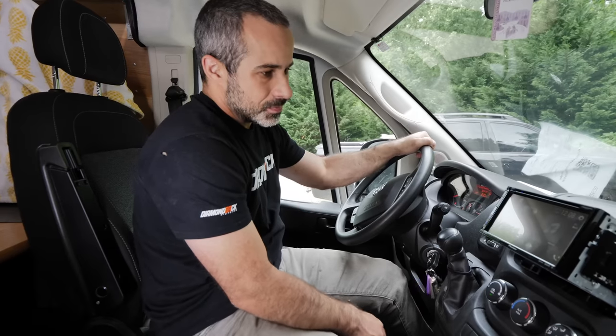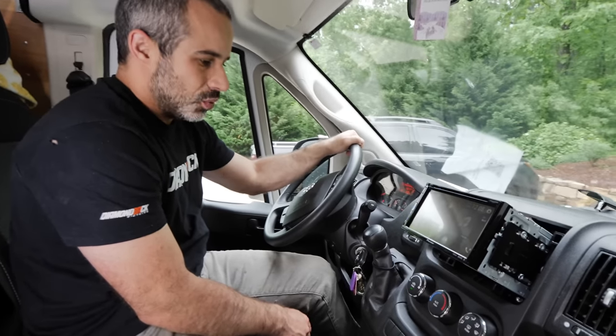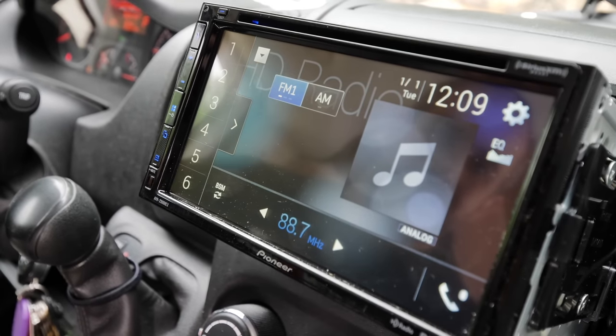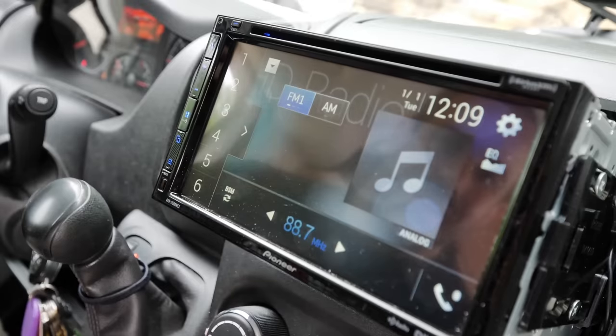Here's the moment of truth. Backup cam — I put it in reverse. Can we adjust the brightness on this one? Watch what happens when I turn your headlights on... there it goes. Now watch what happens when I turn your headlights off. It's hooked up to the illumination wire, so you have automatic dimming. That's actually so nice — your factory radio didn't even do that.